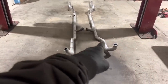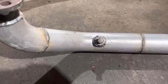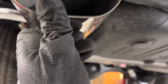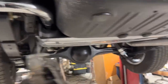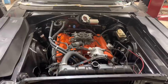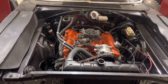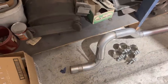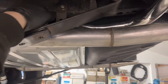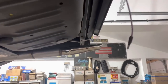Exhaust time. I have to add an oxygen sensor bung there somewhere. Oxygen sensor bung for the EFI installed, welded in place, and plugged for now — I don't want to ruin the new sensor by breaking in the engine with it in there without power. The exhaust system is definitely going to need some work. It was held to the frame rails with self-tapping screws, and there was a gas tank in the way. Apparently these are GTX exhaust tips and they're supposed to have a holdy bracket here too, which of course this thing doesn't. Got the exhaust bolted to the car for now. I did get proper hangers, but I'm just using the self-tapper holes because they're actually proper bracket hanger thingies for these GTX tips, and I don't want to finalize the height of the pipes until I know those are going to fit.